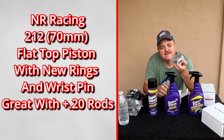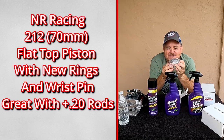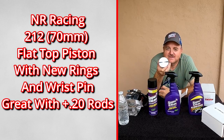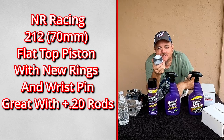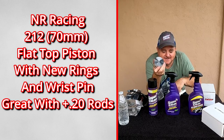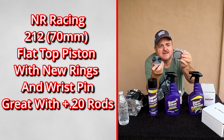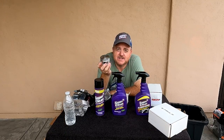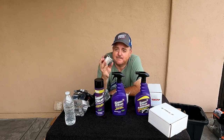And yeah, this again is gonna be one of those parts that boost compression, get rid of that dish piston, and it comes with new rings. Never put rings on. We're gonna have the first time doing that, and we're gonna stick them in the hole and make sure that they're gapped properly.